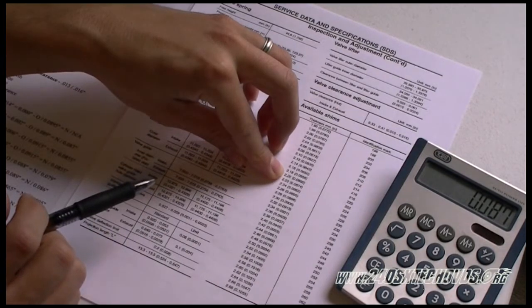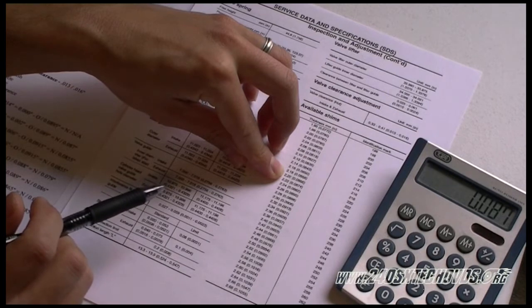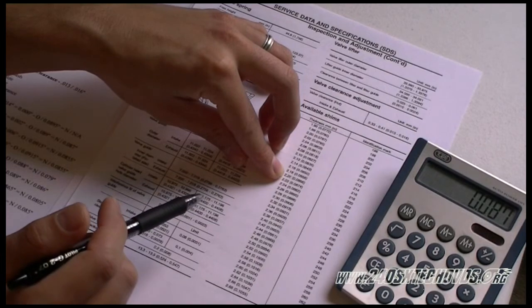We'll actually be over 0.014 just a little bit. It'll probably be like 0.014½ of valve lash, but that will be okay, because again, spec is 13 to 16. You have that much leeway to get in between. You actually want to get as close as possible to your target valve lash on every single one of them for the best performance.